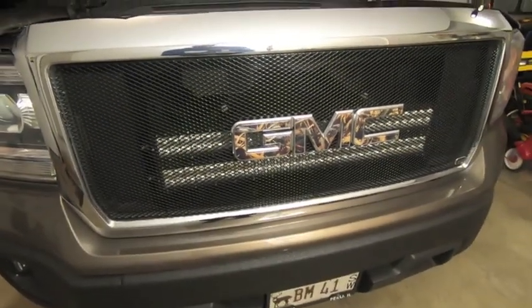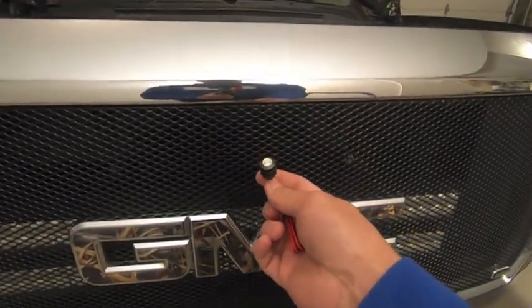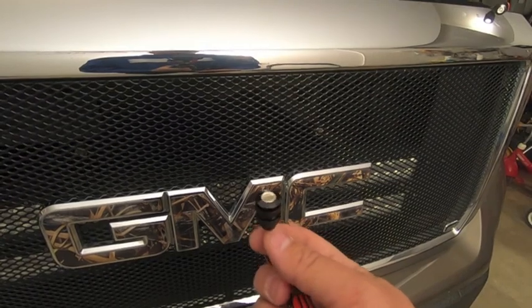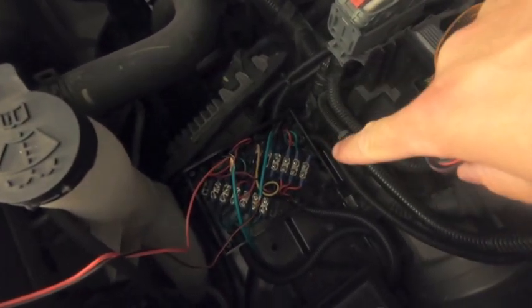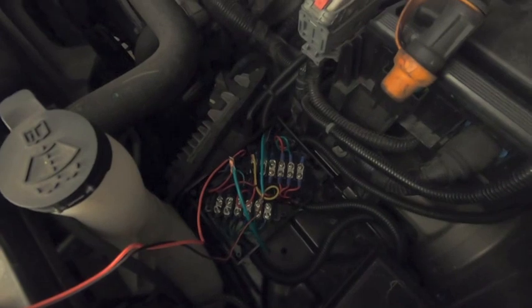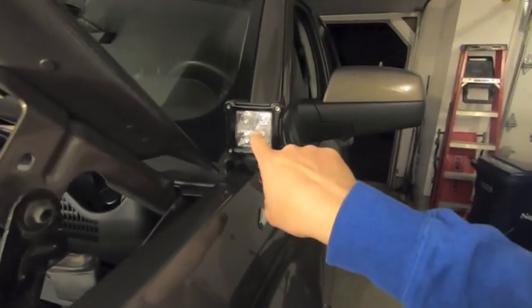In my application I'm going to back both nuts off and have the rim mount up against my grille. I have the Grillcraft MX series mesh grille in black, so the black light matches. We're going to put one right in the middle and then about seven and a half to eight inches out to each side. These things basically disappear — the light itself is small but packs a punch for one watt. I'm going to wire these to my clearance lights via a light control box that already has my light bars and DRL circuit signals pulled into it.